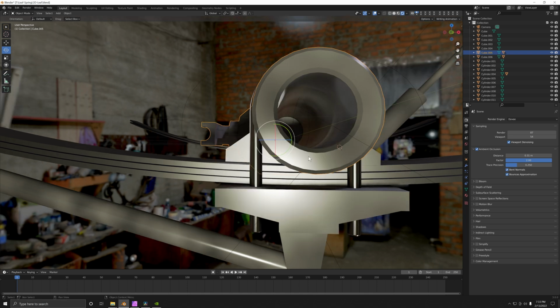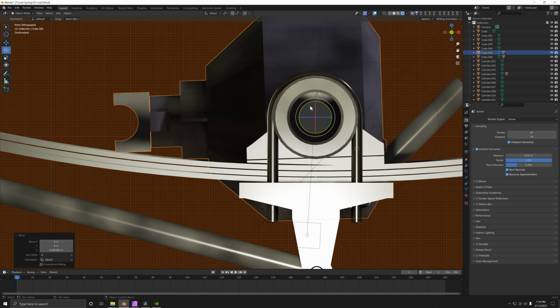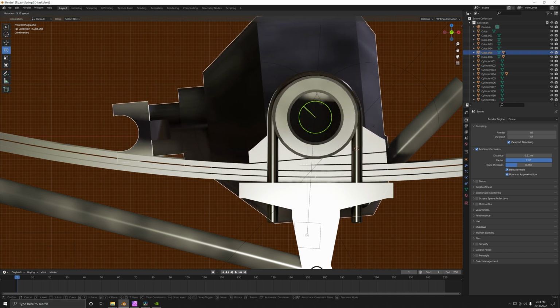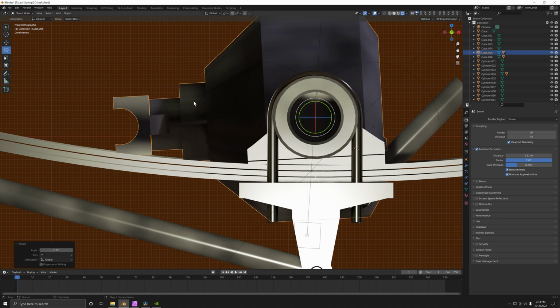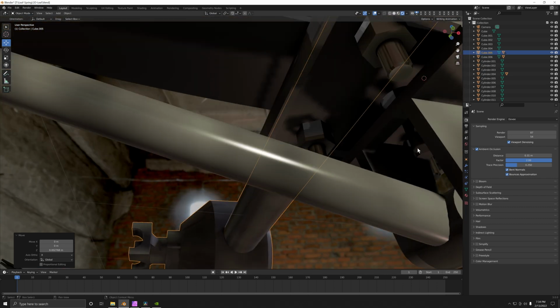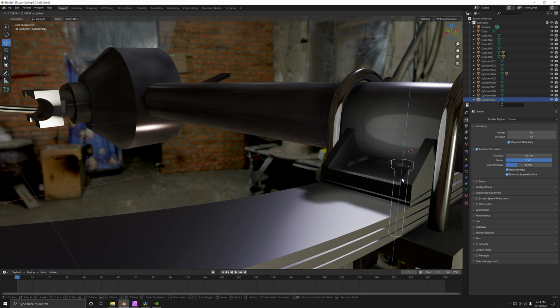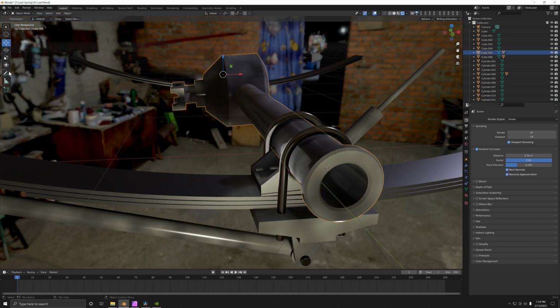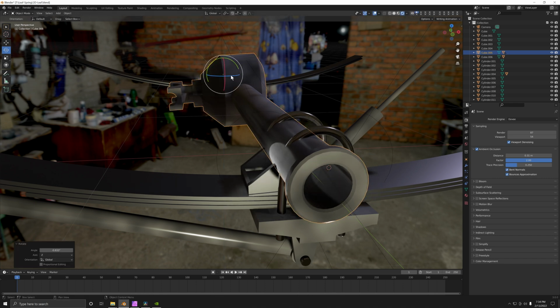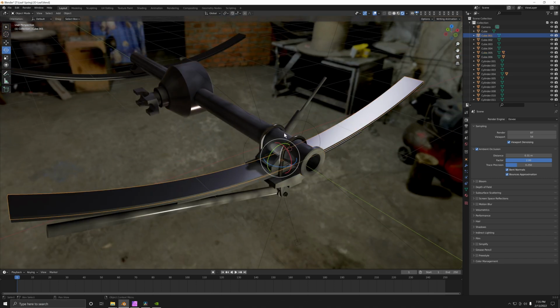So the way I corrected it was with those shims. Let me go back to the side view. Let's put the shim up right here. So we're just going to move it into place. And now, oops, this program is being difficult today. So now you can see when this is bolted down, it has a way better pinion angle. So look at it from the 3-dimension. And of course, this piece right here, when you go to pull this apart, this needs to be in your perch because that keeps your perch from sliding, just for reference, that way or that way. That keeps it centered on your leaves right here. So that is very important.